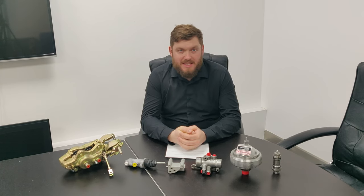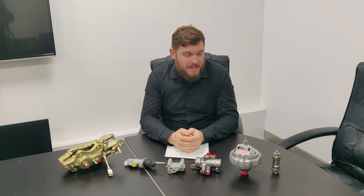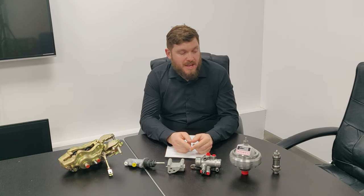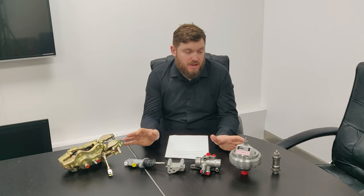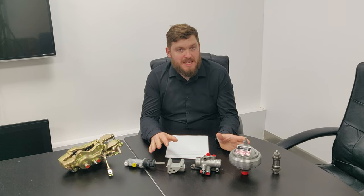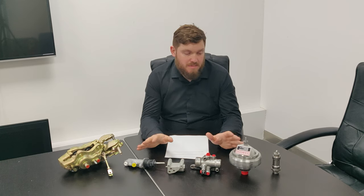So in 1967, when the Silver Shadow was introduced, it had a completely different type of braking system from the cars previous to that. The cars before that had a servo-assisted braking system, and the Silver Shadow had a high-pressure hydraulic braking system. I'm going to run through the components on that system and then talk about bleeding it. It's basically the same as in the Silver Spirit, but a different type of fluid, different accumulators and valve bodies, no master cylinder, but we'll get to that.